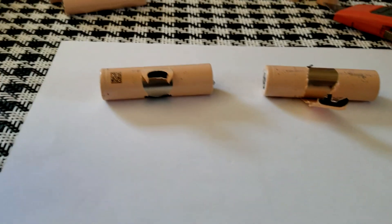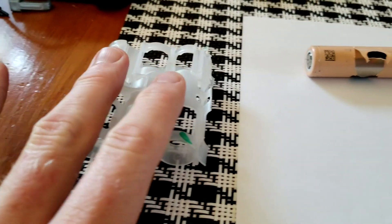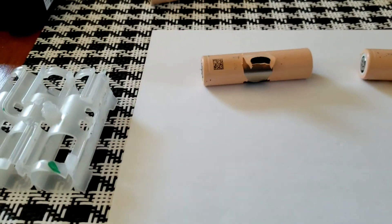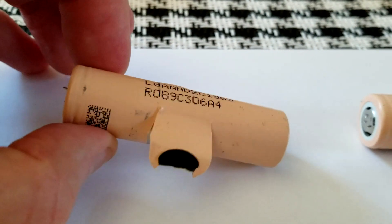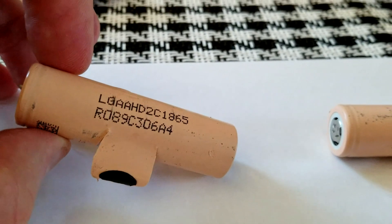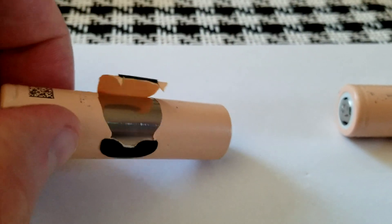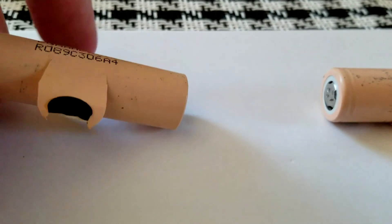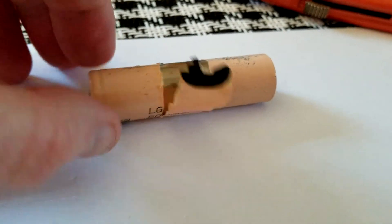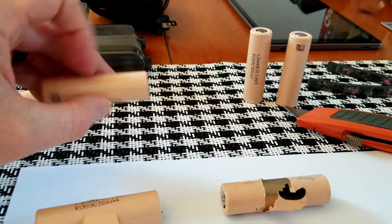The only problem with the cell pack is that right in the middle there was almost like JB Weld connecting the two together — three cells on one side, two in the middle, and one on the very end. Unfortunately that JB Weld ripped off the cover on those two cells. You might comment below if that's just a scrap cell or not — I think we could wrap it with electrical tape, but you definitely don't want to be shorting that out with it exposed. The cover is not pierced at all, just flipped up a little, so electrical tape should save that cell.